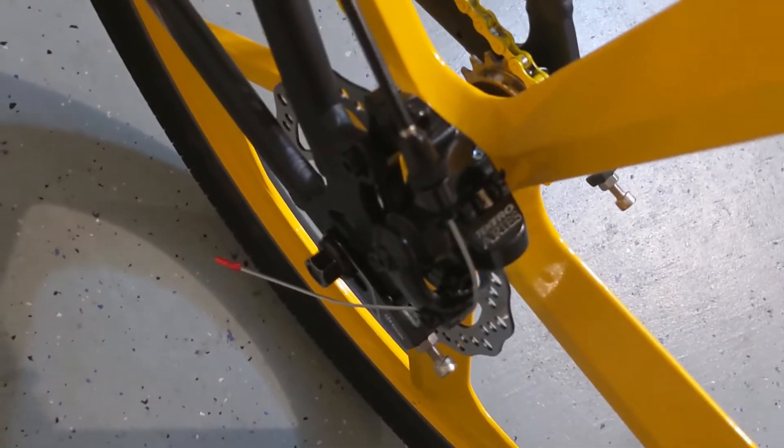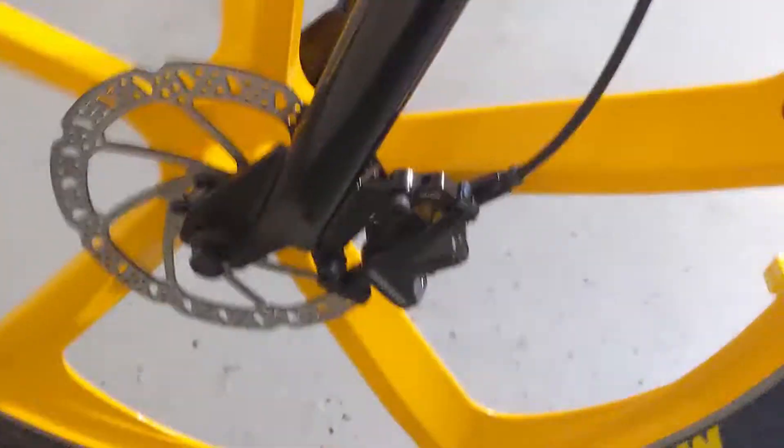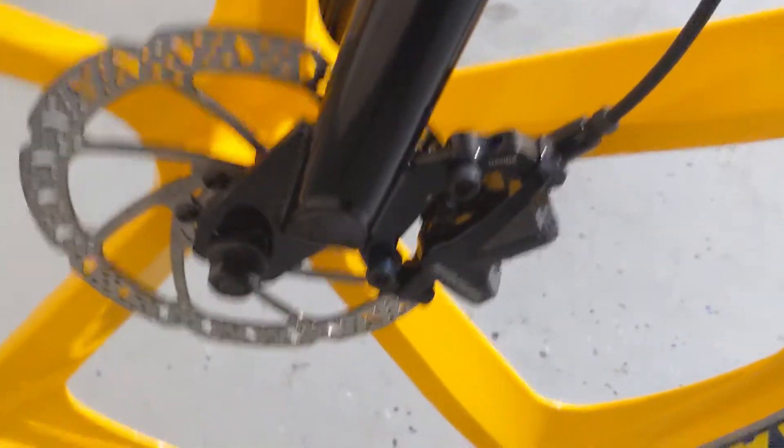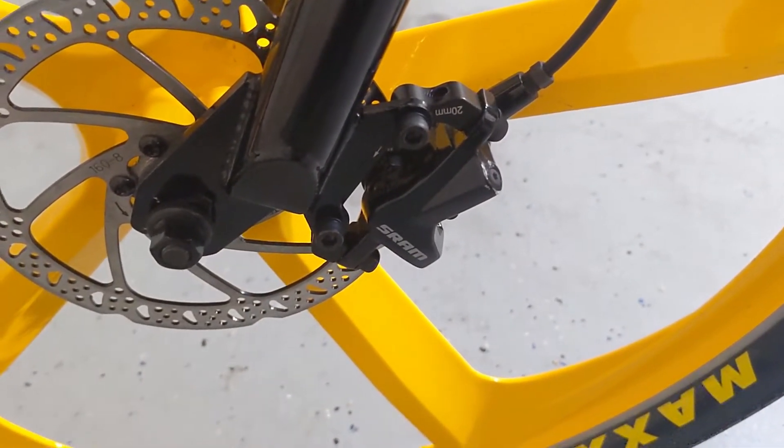That was the main reason I bought this bike — the disc brakes. It comes stock with the mechanical rear Tektro Ares 160 rotors. I've got the Pittsburgh sticker on this side, and I put the 160 rotor up front. I had the mounts. Most bikes don't have the front mount — you have to use some sort of adapter. But this frame has the mount, and off Amazon I got the other piece mount to put on for the caliper.